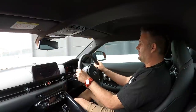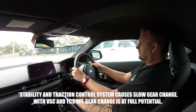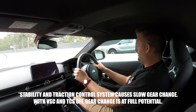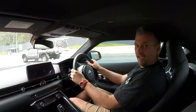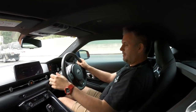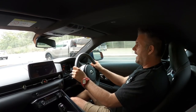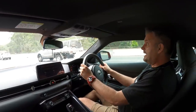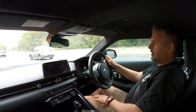She's certainly got plenty of extra grunt. I'm even finding that the gear shift has actually been slowed from second to third as a bit of torque reduction. The extra 90 horsepower is definitely there. The car used to have good mid-range torque and come on real nicely — now it's got some top-end charge. What you can see on the dyno is definitely happening in real life. I just saw the thing use some torque reduction on a gear change, which is the first time I've seen it. Traction control warning light comes on pretty easily in second gear now — before, it used to only come on in first. It's fast. And the best thing about it is back into auto mode, back into normal driving, and now you have a nice luxury car again.